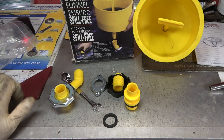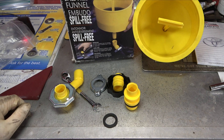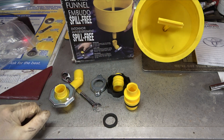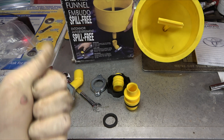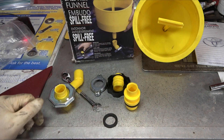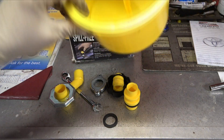It really works well for getting air bubbles out. If you're going to fill a system, I have an airlift system on a lot of cars and I'll just use that — it pulls a vacuum and maybe someday I'll show you that system working. It pulls a vacuum, the hoses all kind of pull the air out and the hoses pull tight, and then water rushes in when you insert the coolant that way. This system works well on Lexus, Toyota, and Hondas.